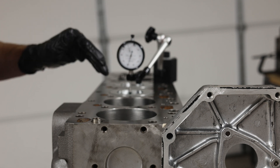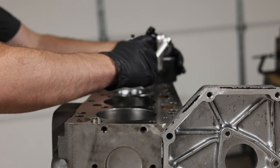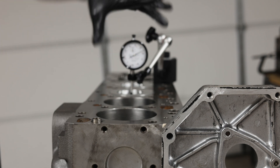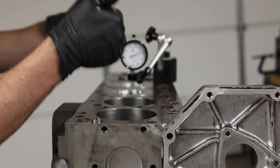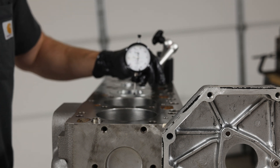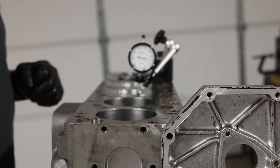We're just going to move our dial indicator off of this piston and measure how many thousandths of an inch we get. Let's zero out our dial indicator. We want this spot to be as close to the edge as we can, and right in the middle where it says front. The piston's going to jostle left to right on the compression and power stroke, so we want the most accurate reading front to center. We can see we're zeroed out, and then we'll slide it off the piston onto the deck. We have a subtraction of about 25 thousandths, which is about right within spec — spec is actually 24 to 28 thousandths for these particular pistons. So we are within spec on this cylinder.